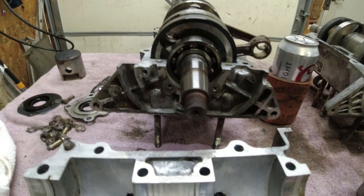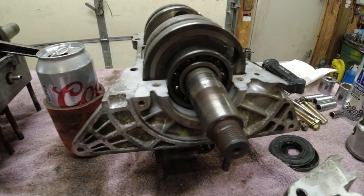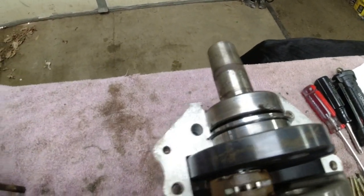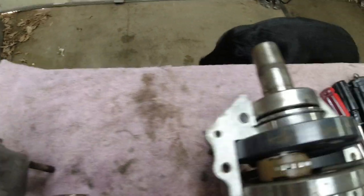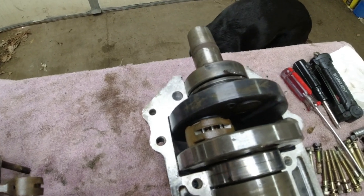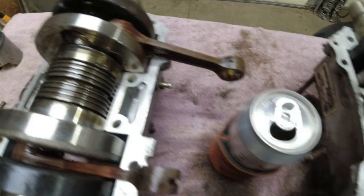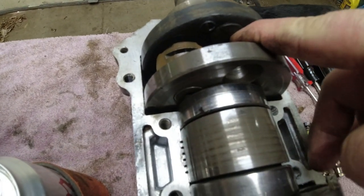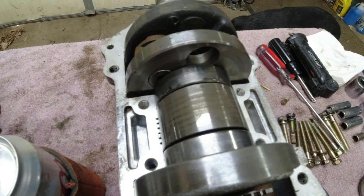When you look at the end pattern for the recoil housing, it's the same. The crank stick out is the same. I mean, because we're changing things up, we'll still verify clutch alignment, but they both use the deep bore clutch. Both of them had these corks that you can see here in the holes in the crank.